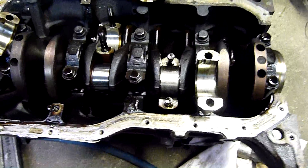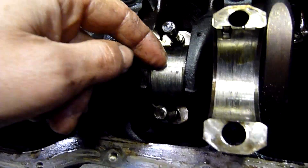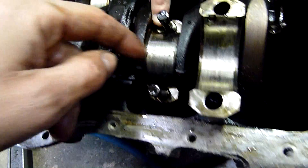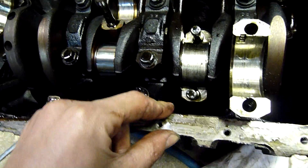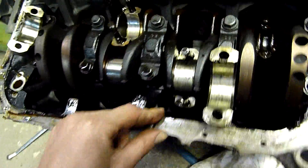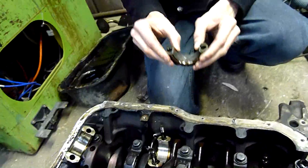Well, we've found the source of the knock. That's not supposed to be there. It's welded to the crankshaft, part of it's come out the side. Oh no, it's on top of the other cap - it's on top of the other shell. There's the upper shell, there's the lower shell, and they're overlapped on top of each other.